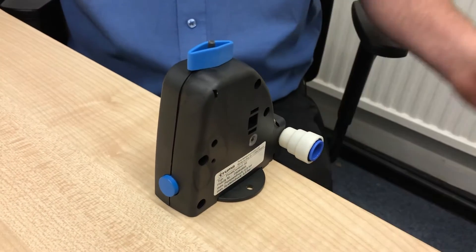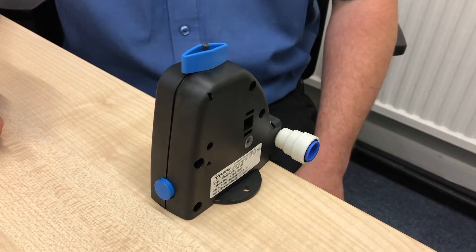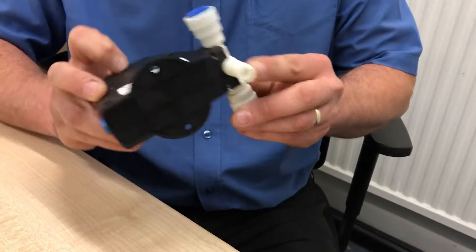There's a clear plastic tube about that long and it'll be pouring out onto the floor underneath the motorhome. Because your taps are open, air will be able to get sucked in to displace the water so it'll all drain. It can take a good 15 minutes or so because there's quite a lot of water and it's only gravity emptying it — you can see how small the pipe diameter is.